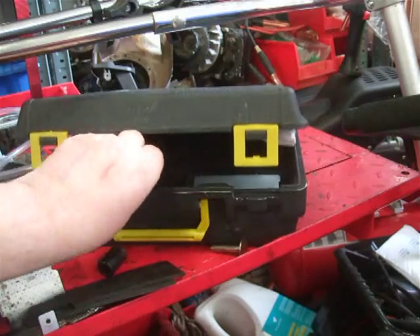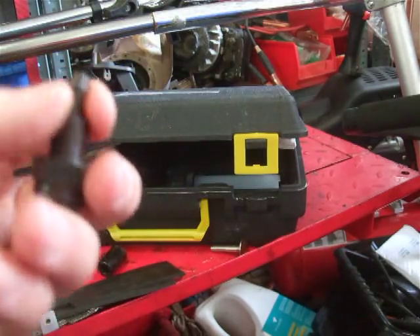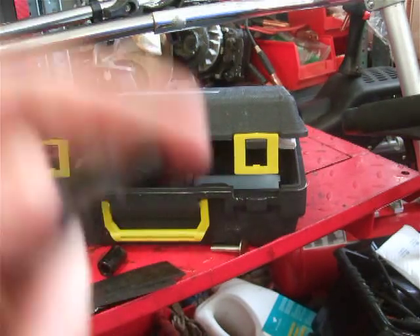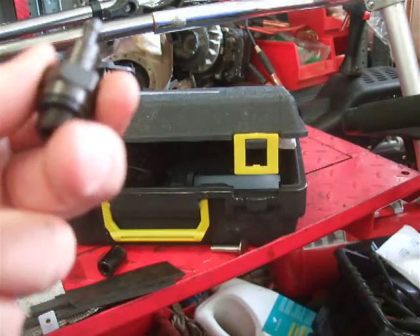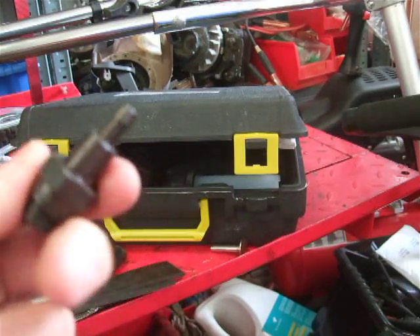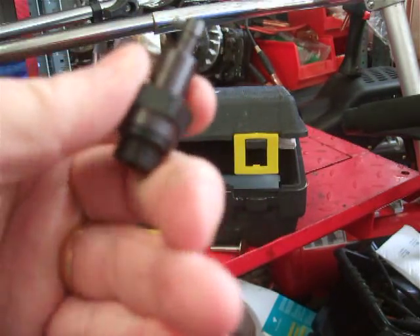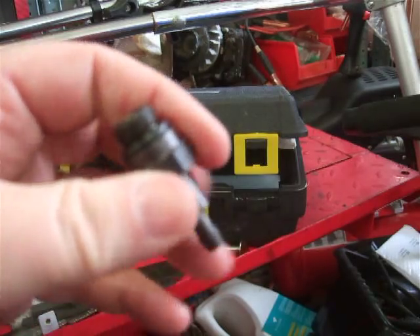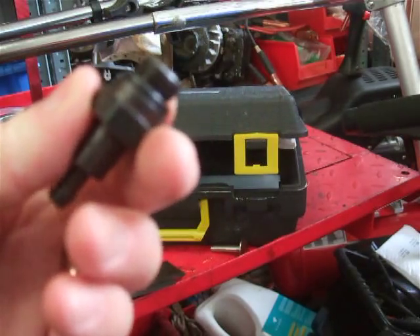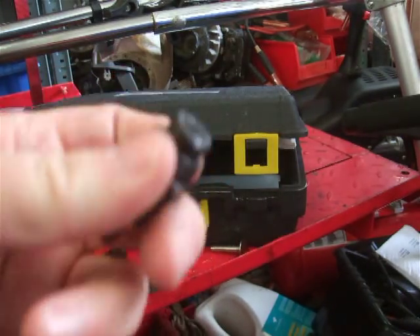This is the other tool you need — or something like it. You can make one of these from a spark plug. Remember, this is not a compression test — this is a leak down test, so you don't have the cylinder piston moving. A leak down test is testing the bottom end of the two-stroke engine, not the top end where a compression test would do. This fits in there. The main difference is it's got a hole all the way through and a rubber O-ring on it — not a metal washer. It's a standard O-ring, nothing special.